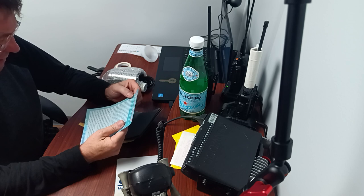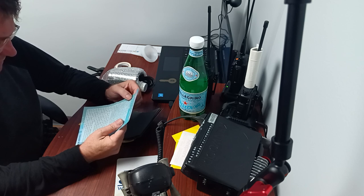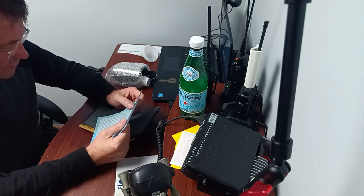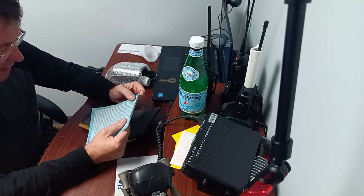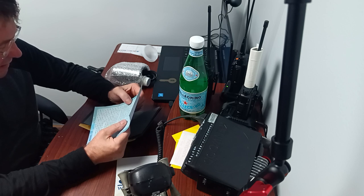Let me read the instructions: 'Attention — the restoration vehicle must be parked in a spacious, windless, and rainless environment. Applicant must wear a protective mask and goggles. Use 180, 220, 360, 600, 800, and 1200 grit paper to completely polish the headlight. Carefully pour about 100 milliliters of restoration solution into the electric heating cup and cover the heating cup with the sealing.'